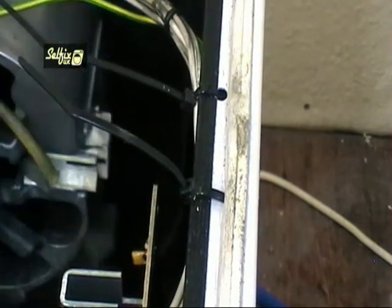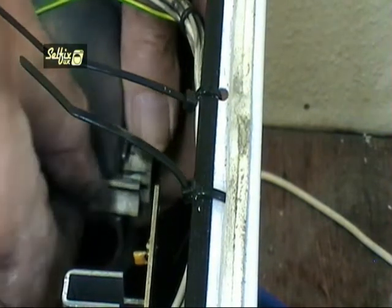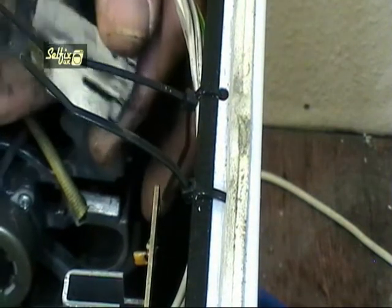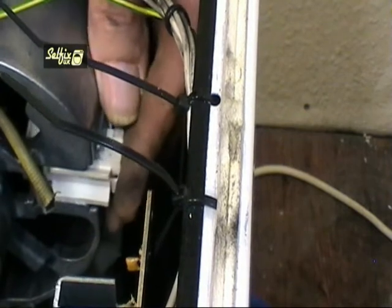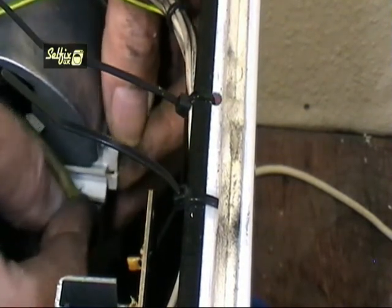Depending on your method of removal, the side closest to the cabinet could be easier or harder. You may want to pull the container over to the left to give yourself a bit more room. Unfortunately, this will occupy one of your hands, so if you're using a screwdriver to lever the brushes out, this may pose a small problem. However, the new brush assembly will fit very easily on this side, but remember to push it all the way in. You should hear a click as it locks into place.